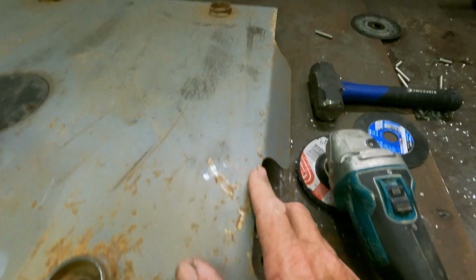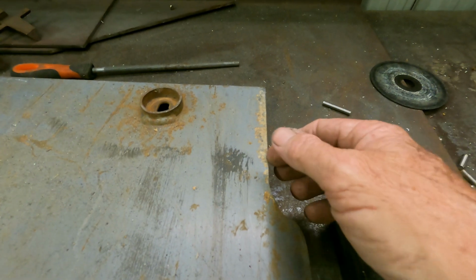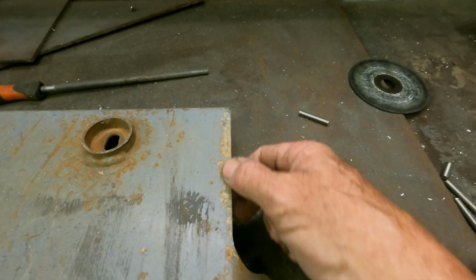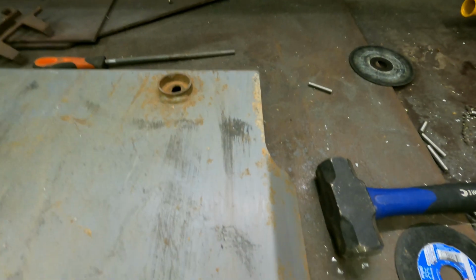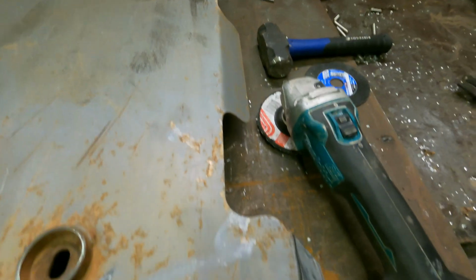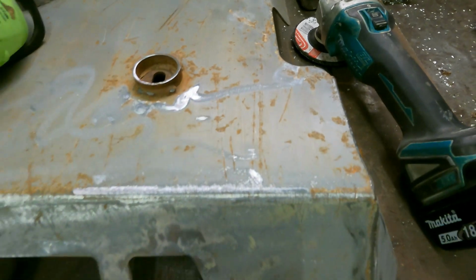It just can't grip on those really sharp corners. You can see it here too. It's just given way right along that edge. That's where the water gets under the paint. And I think this is powder coat actually. And away you go. The rust gets in and so on and so on.